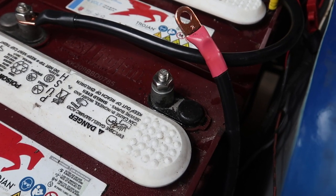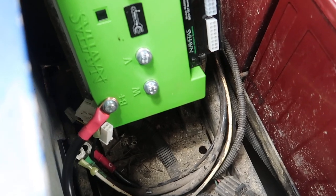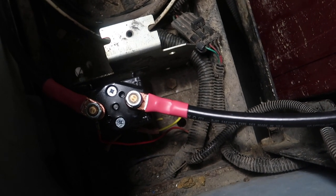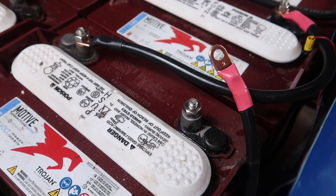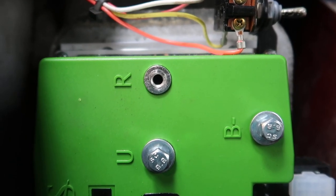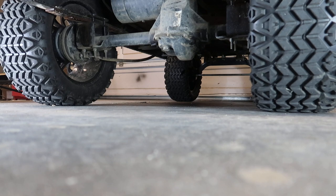There's a contact connector here and a contact connector here — this is for the activation circuit. We're going to replace all four of these with the new one. However, once we replace the solenoid, we're not going to use this resistor here that's connected to the big terminals. We have a power wire going from the positive side down into the top of the new solenoid. The new solenoid wire on the other side goes up to the positive side of the controller. We mounted the solenoid in the stock location, used the two wires going into the solenoid from the old one, put some new terminals on them, and plugged them in place. What's left is to hook the power wire up to the positive on the battery pack. We aren't going to use the R terminal of the controller. Next we need to mount the B-negative to the B-negative of the battery pack.